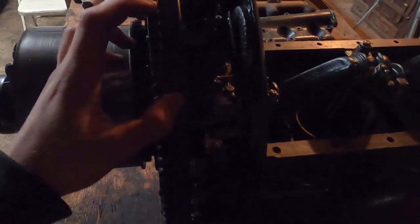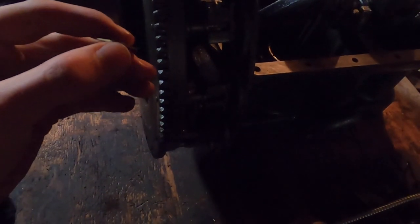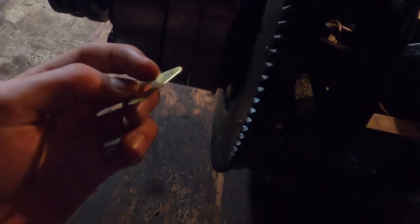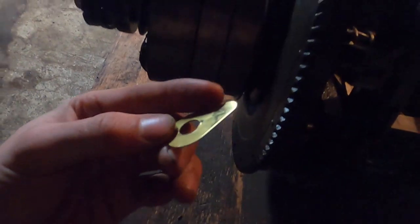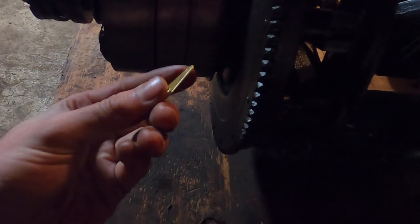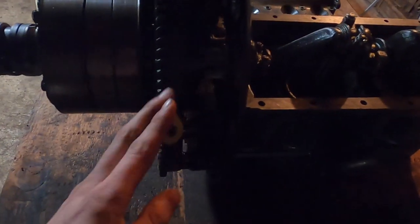I don't have one, so I'm going to do it the rough way — taking it back off and putting the shims in. The shims are little pieces of laminated brass, 32 thousandths thick total, with 2 thousandths inch laminations. The easiest way to remove laminations is to hit it with a propane torch real quickly, then with two pairs of pliers it'll start to peel — you can peel one layer off at a time because they're basically soldered together. I'm going to peel these down to what I think the right sizes will be for the first try.